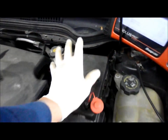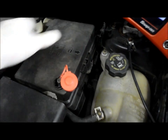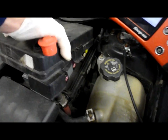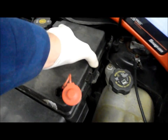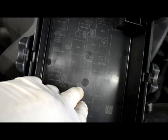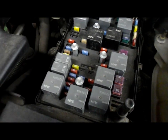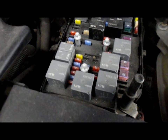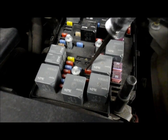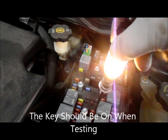On this particular car, the fuse box is located underneath the hood right here. So we're just going to pull this cover off and then we're going to test the fuses. If you look inside the box, we're going to look for an emission fuse. And there it is right there — we're just going to check it to make sure that fuse is good. And as you can see, that fuse is good.